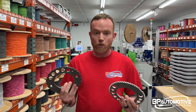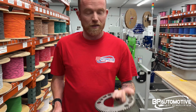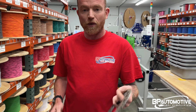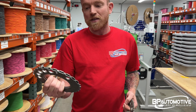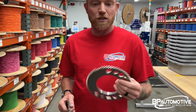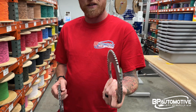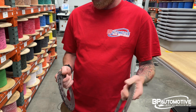What's up everybody, this is Bill with BP Automotive. Today we're going to talk reluctor wheels. You've got a 24x reluctor wheel and a 58x reluctor wheel. Generally the 24x is going to be your 1997 to 2006, roughly early 2007 in some applications, and the 58x is going to be your 2007 and newer LS-based applications.